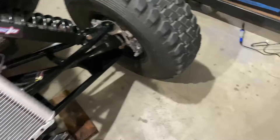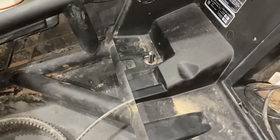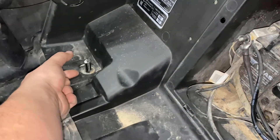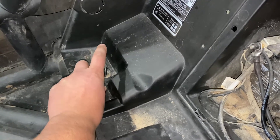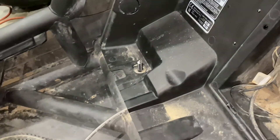When you take off the old seat you don't have to cut the studs like we did, but the only reason we did that is because the studs are really long when they come from the factory. They come with a spacer that sits down here and it adds probably two to three inches above that. So we just cut it down so it's easier to get a smaller socket on.